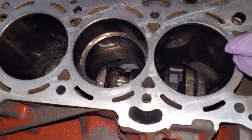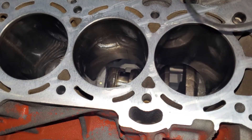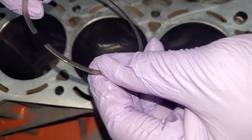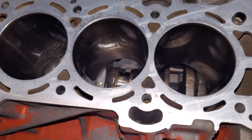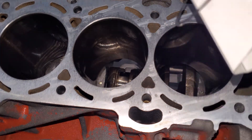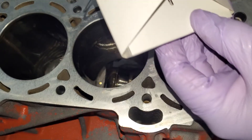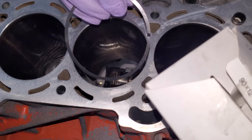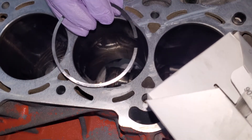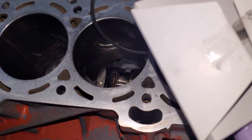So we have a lot to take off for this one as well. It looks like for each one of these, the top ring seems to be fine, but the secondary ring seems to be the one that needs the grinding. That's pretty much how you do it when you're calculating the gap and seeing what the actual feeler gauge is showing for your gap. Pretty cool - stay tuned.